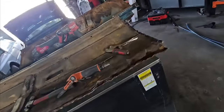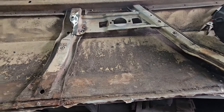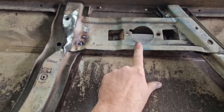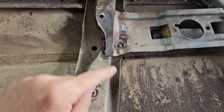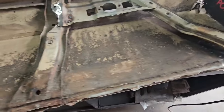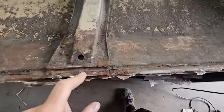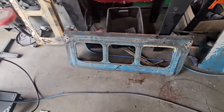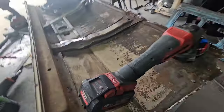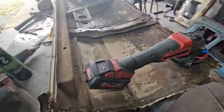Putting in this inner structure for the winder for the back window. This section is all in now, spot welded in, got a new spot here I'm welding in. Started on the back but I'll move around to the front to finish it off. Clean this section up, rust treat it, move over to this - clamp it all down, make sure everything lines up. It should because it's all on that - it's only the outer skin that's different.